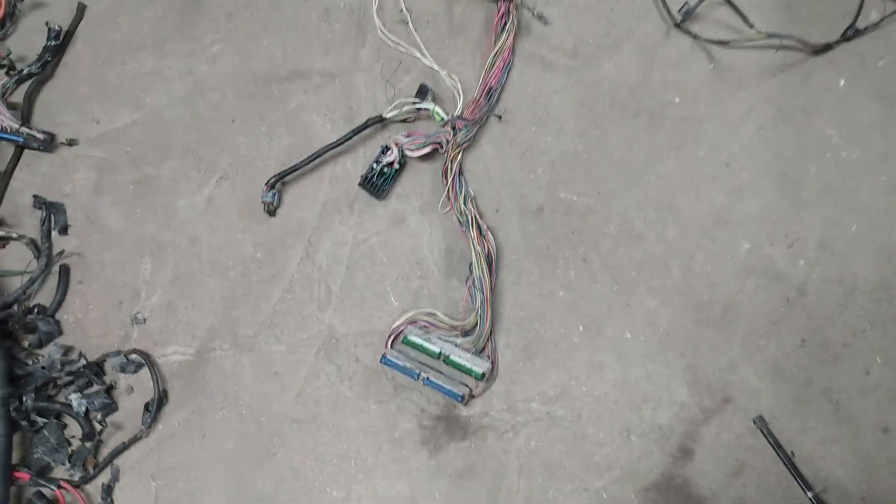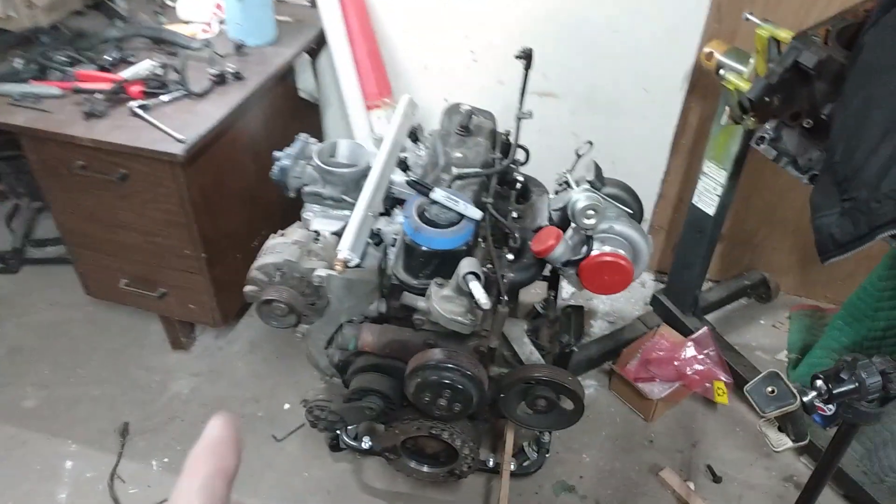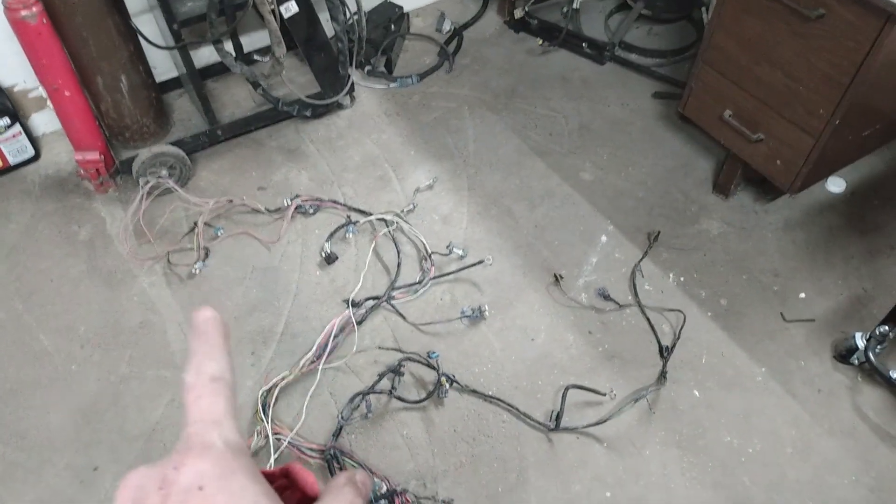So we got this thing peeled all the way down to the connector because we are going to be removing wires. Nothing really too strange, and these white wires — someone must have spliced these in, but the splice job looks really good. Usually I don't see that kind of quality on splice jobs, but we'll have to check all that to make sure it's going where it's going. Now, a couple of things — since we're putting it on a four cylinder, we only need four injectors. So for these injector leads, four of them are going and we'll have four left.